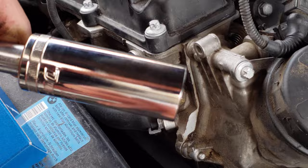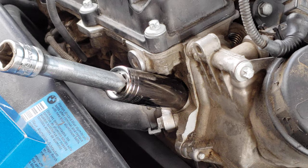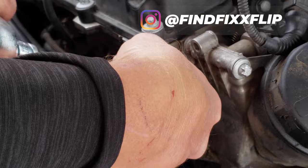I decided that my overheating issue was caused by a bad coolant temperature sensor, shown here. It can be removed with a 22 millimeter deep socket. Turn the ratchet counterclockwise and support it to make sure that you do not strip it out.